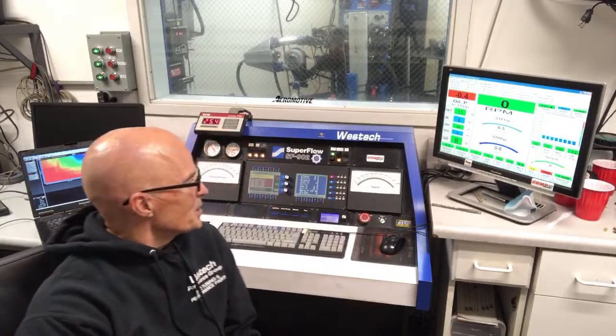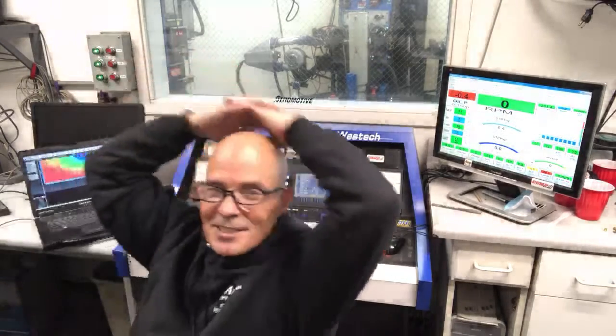Australia's in the house. Yeah, I'm gonna send the heads over to Eric. The cam that's in it currently is a ZZP cam. It's a 507, 220, 230 at 50. It's gonna get more boost, just not all of it right now.